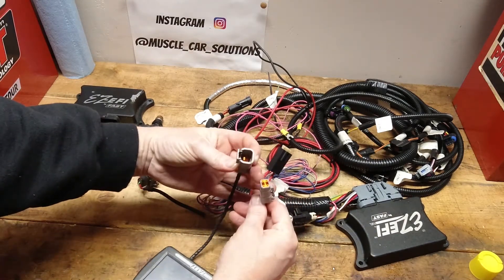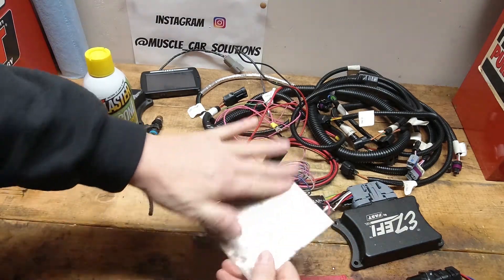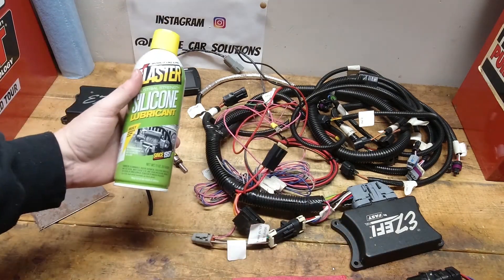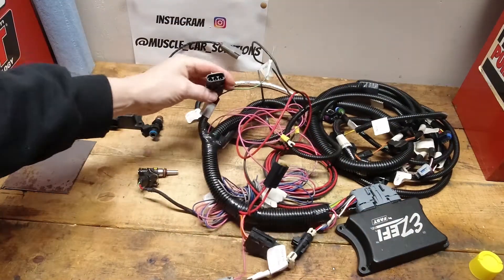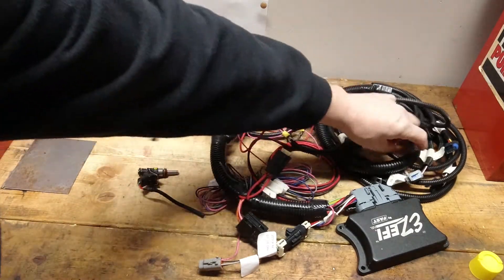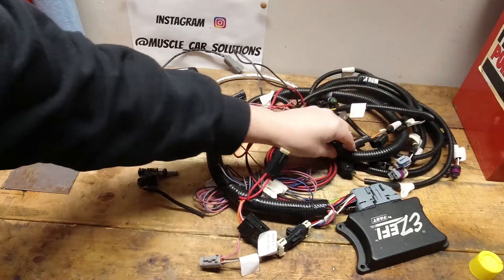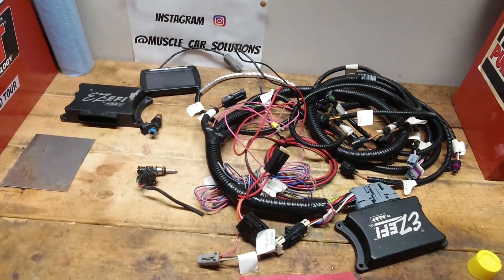Let's take a quick look at that sheet metal to see how quickly it dried. After about 15 minutes of sitting there in a fairly warm garage today, it's completely dry — and that's what you're looking for. A good silicone spray will dry within a reasonable amount of time, and that connection will be together solidly, lubricated a little bit but still sealed up and operating perfectly. If you have any questions, leave them down below. The big tip here is don't get it on the connection, but it's okay to get it on the seal.